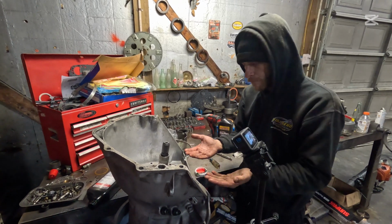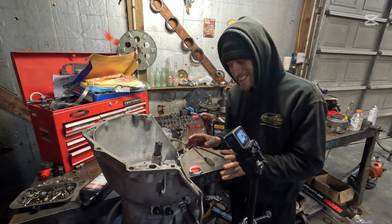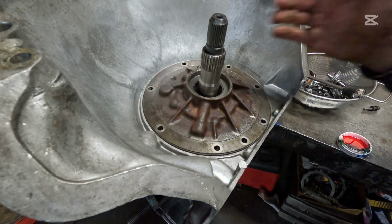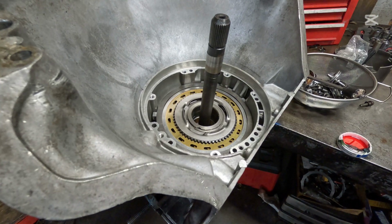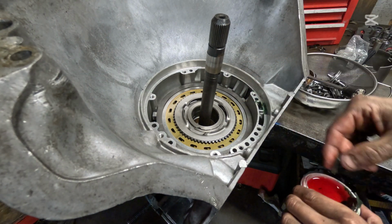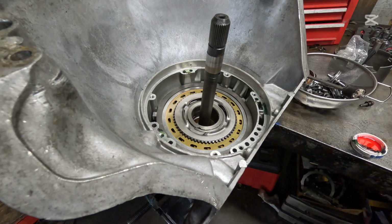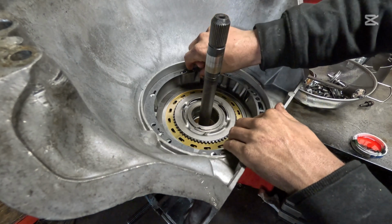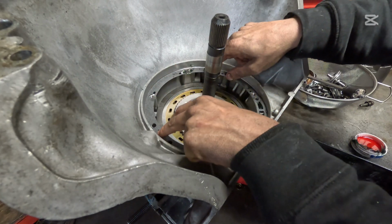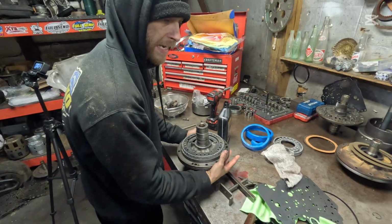Once we add the gasket, it's going to bring the pump back just a little bit and give us a little bit more, and then we'll finally flip it over and do a final check when everything's in there and seated properly. So you're going to pull this back out, take your pump back out, put some grease around where your pump rides here, just like that. You're going to take your gasket here and put it in just like this with your 2 eyes on the top there. Make sure that's sealed in. And we're going to flip this back over.